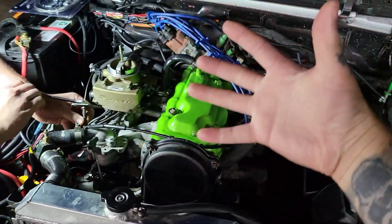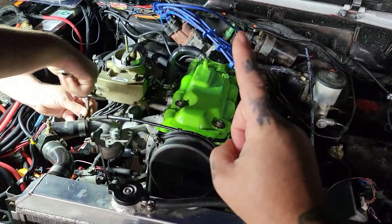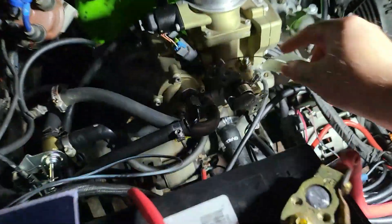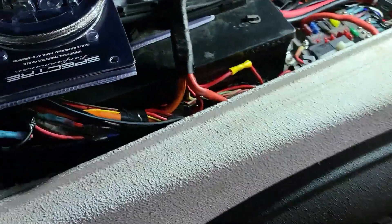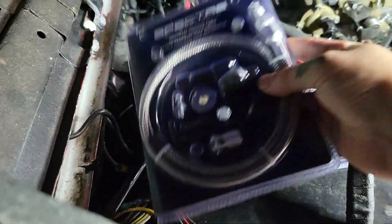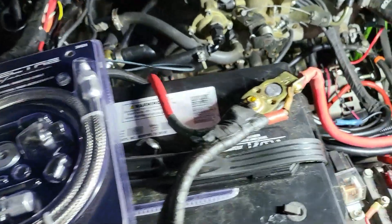It hits good now. Just because you buy a new part doesn't mean it's good. What we're doing now is trying to get this throttle bracket set up on this Sniper better, because they had it where you could only go to 47 percent wide open throttle. They had an odd bracket set up on it. We're going to change that bracket with this one from AutoZone — with our discount it was like 40 bucks.